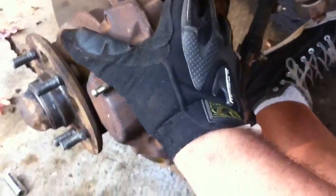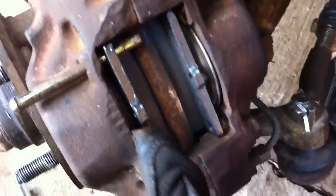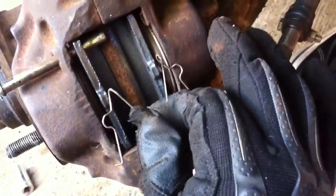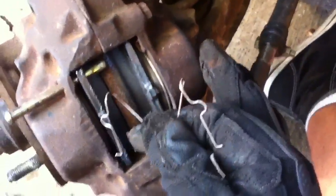On updated calipers, you pull the caliper off and your pads pop out from the other side. With the '75, you don't have to pull those bolts off — I've never done this before, so I'm learning. There are actually pins and keeper keys on the inside and outside edge. You pull those keeper keys out and then slide the pins out. Once you slide the pins out, you can grab and pull the pads straight out. There's also a spring that keeps the pads pushed out so the caliper can float. They needed more contact pad on up-to-date vehicles, so the pads come all the way up and down now instead of just small ones.